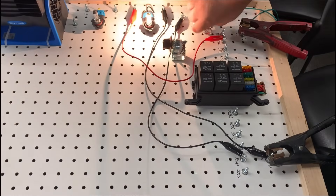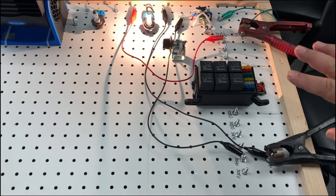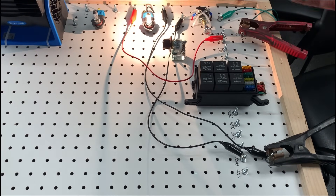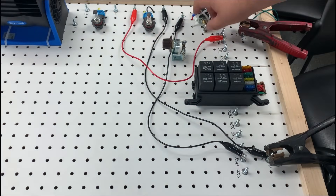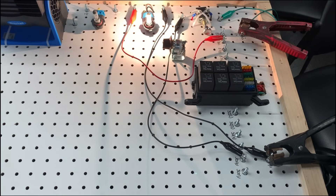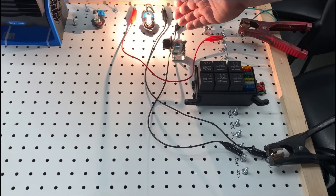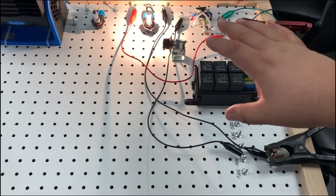My ground here is running a fixed ground to my light bulb. So as you guys can see, this circuit is working perfectly fine. I went ahead and pulled my pull switch, which can act like a normal headlamp switch or whatever switch you want, and my light comes on nice and bright. So now let me set up my voltmeter so I can take some basic measurements, and show you guys how voltage drop works on a good circuit.